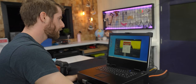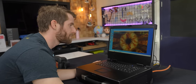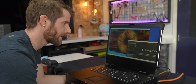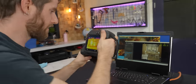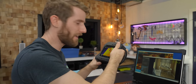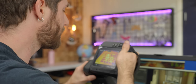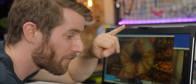I think there's more we could do to stress this thing — let's hit it with Furmark and Cinebench at the same time. It's definitely getting louder now, but I think it's pretty reasonable. The wrist rest has cracked 50°C. The keyboard — did I see 60°C? Still though, our GPU is just shy of 2.5GHz and our CPU hasn't thermal throttled yet.